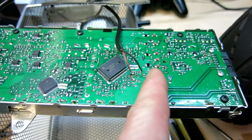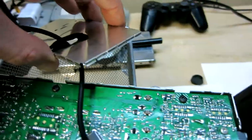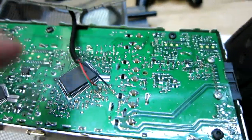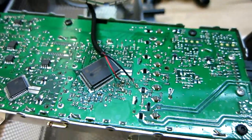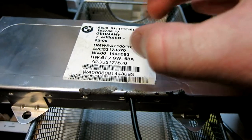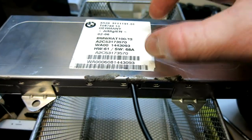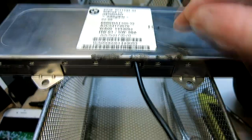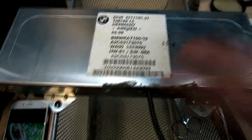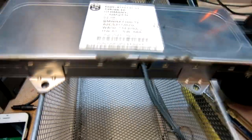And again, there is a point where it hits the ground, so we're actually going to take our pliers and remove the third flap right there, the one that would actually touch the ground on that black one. Okay, and the inner one I didn't lay down and smash down because the cord actually raises it up just a tiny bit. So what I did is I held down one end of it here. I put the cord down again the bottom. So now with the label facing towards us, right here is a beautiful little already done notch. I just slipped it right down at the bottom there.